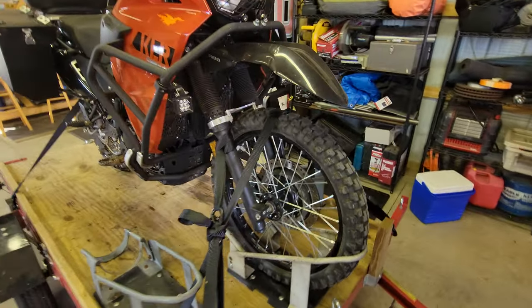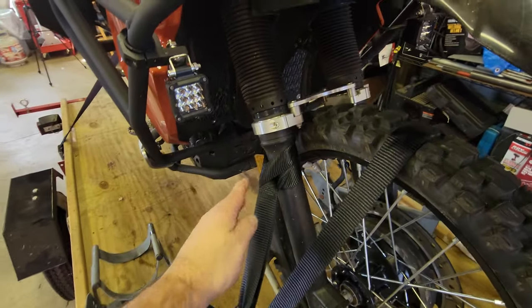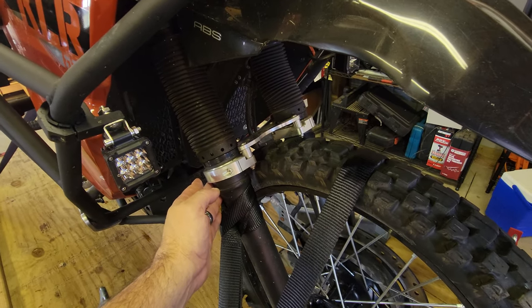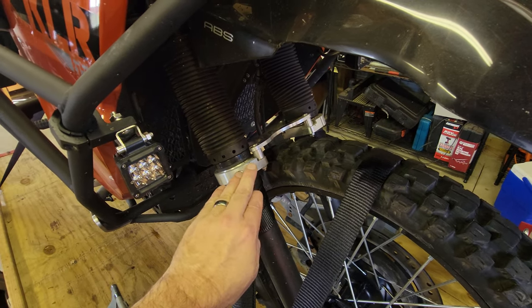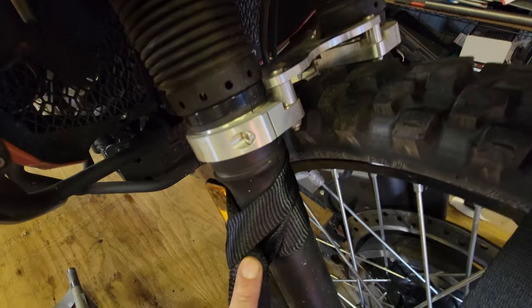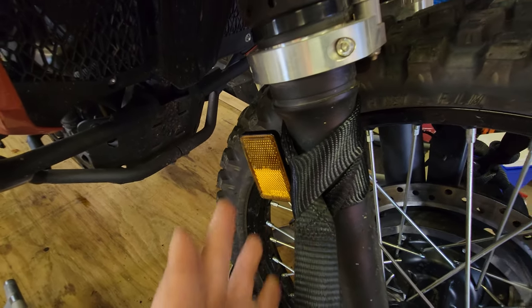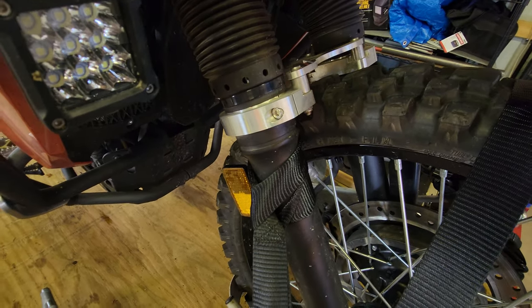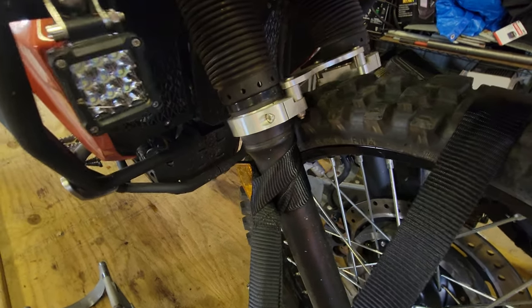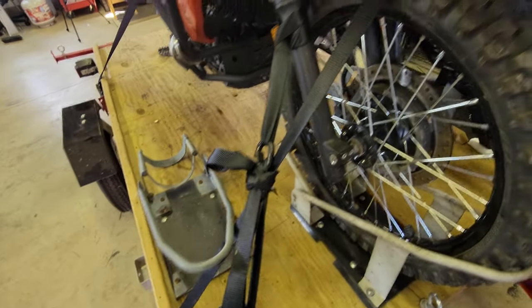You can see how I have mine set up — I have my straps on my lower fork tubes, up at the top of the lower fork tube. Normally I would go higher, but due to the fact that I have this fork brace with sharp edges, I decided to go a little bit lower, utilizing the tab for the reflector. I did put some tape on that to protect the strap from getting cut. From the lower fork tube it goes to the corner of the trailer.